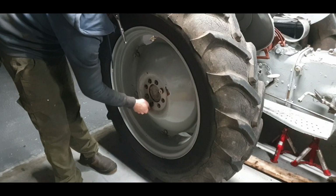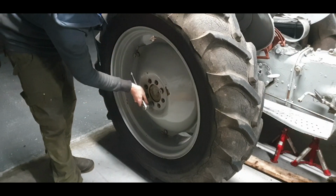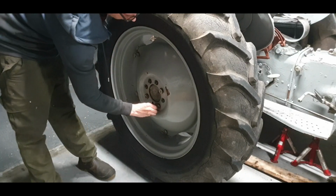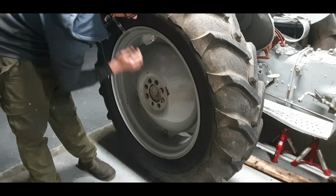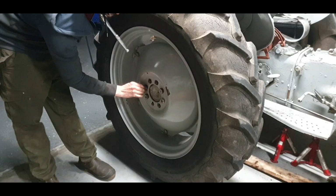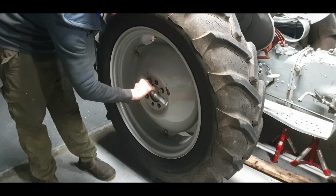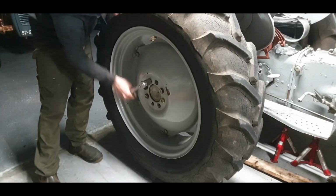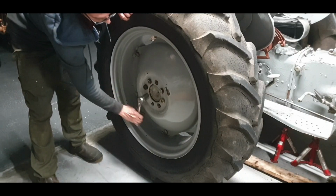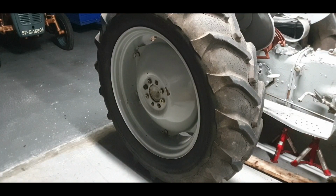So that's just full of coolant there, so there was a massive coolant leak because I forgot to put the brass blank for the thermostat, for the temperature gauge if they don't have. Forgot to put that in, put it in, sealing washer, and it looks good so far. Then the Indian head is squeezed out all around the thermostat housing, so that's what we want to see. So yeah, I'll throw this wheel on. And we'll see, might give it a quick start then and see.